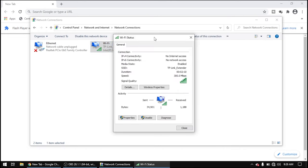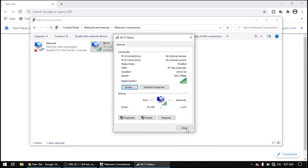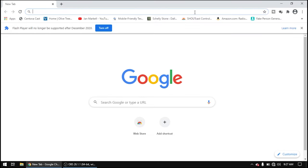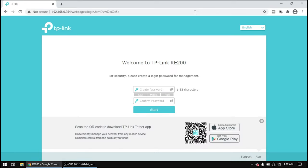Click on Details. Here is the IP address for this computer — the Wi-Fi extender assigned me 192.168.0.100. But look at the default gateway — it is 192.168.0.254. This is the default IP address for the Wi-Fi extender. Just type 192.168.0.254 in the browser and hit Enter. And here we are on the Wi-Fi extender admin page. This is the quick way to find the default IP address for your Wi-Fi extender.